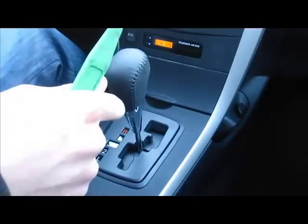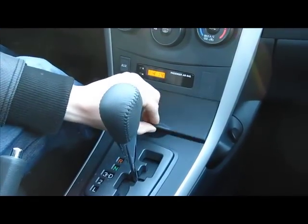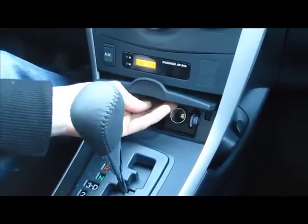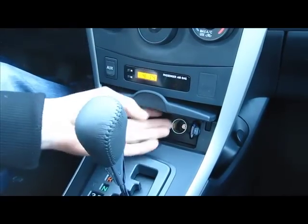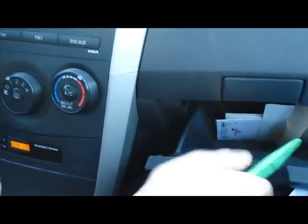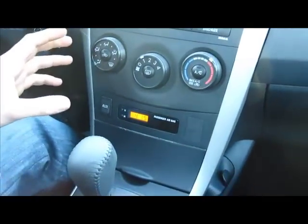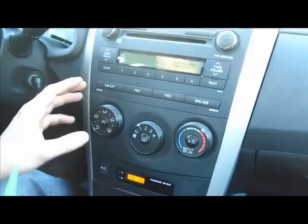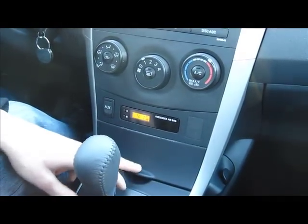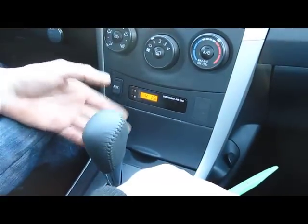The best place in this car to install the kit is through this middle pocket — drilling a hole on top of it and feeding the wire so you have the iPod wire coming out here. You can also do it through the glove box; there's a hole there to feed the wire through. To actually remove the radio and install the kit, you don't need to remove the bottom part, but I'll start with the bottom part since many people would want to install the kit in this pocket.